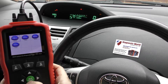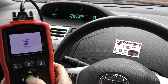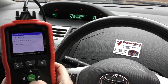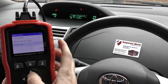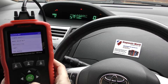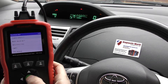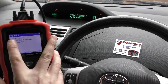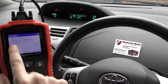We'll click into diagnostics first and select our vehicle — Toyota. We're in Europe so we'll select 'Other Area' and then 'Manual'. We're going to diagnose the engine system first, so that's Engine and ECT. I'll click Enter, then 'Read Fault Code'.